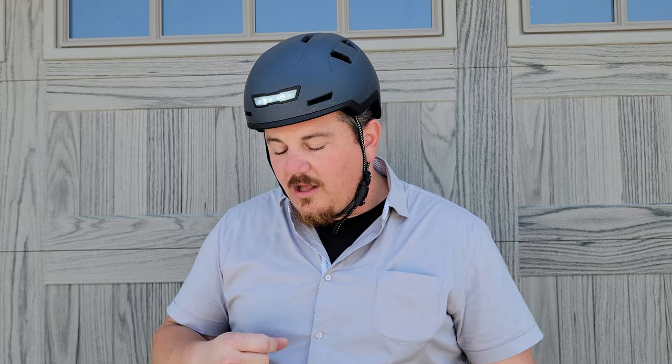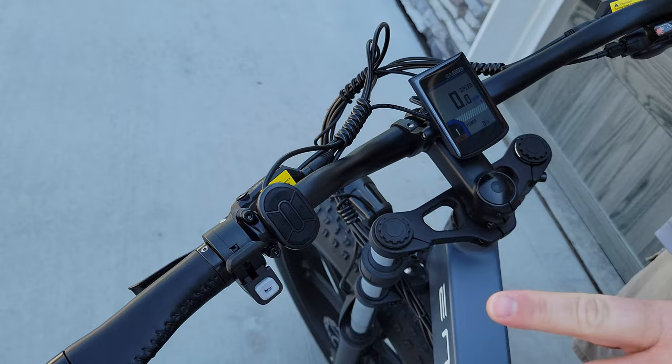It's the cool thing about riding an e-bike: the first time you pedal, you realize, wow, I'm superhuman. But I have learned that I prefer to just have a thumb throttle or a spin throttle. I prefer the thumb throttle. I also like that this one is in a position where you're not pulling into it as you accelerate. That causes self-induced oscillation if you're trying to do slow maneuvering. We don't have that problem.